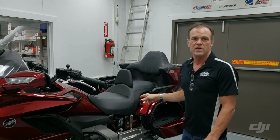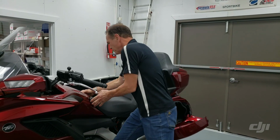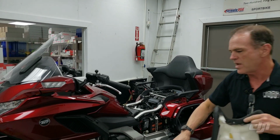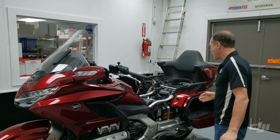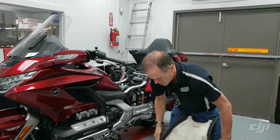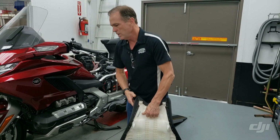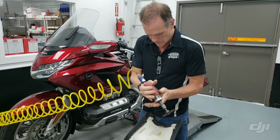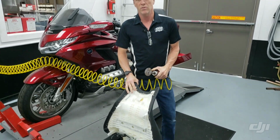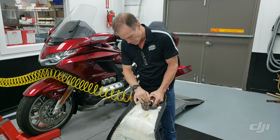I think the reason this seat just doesn't drop down nicely and easily into its appropriate place is because of that tab. So my bike is going to lose the tab. Now I know the tab's not necessary. First of all, the seat can't slide backwards. It's held in two other locations by two different other bosses, these two bosses here. Then it's held by these two tits and grommets on the front, and then it's bolted. So I'm not really concerned about this tab. The only thing I'm sad about is that when I cut this off, it isn't going to make any sparks, like Jesse James did when he worked on motorcycles. I know that sparks flying gets big ratings, and this is just going to be plastic, so I'm kind of sad about that.